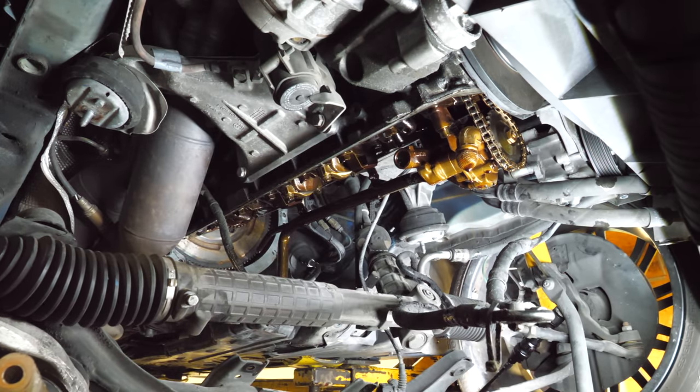The inside of the pan looks pretty decent. No sparkles — so that's always a plus. That's a casting thing. This is good, I'm glad to see this. Next we're going to remove the oil pump nut — it's a reverse thread. Let's put that nut back on so we don't lose it, and then we need to remove the oil pump. Next we'll remove the three 6mm hex bolts that hold the oil pump to the block. Those are really tight, so we're going to use a little extra care.